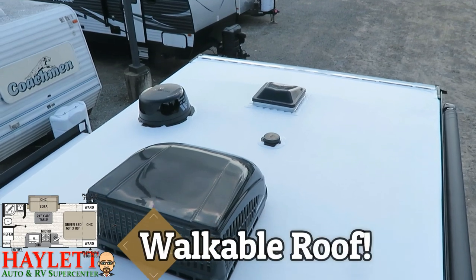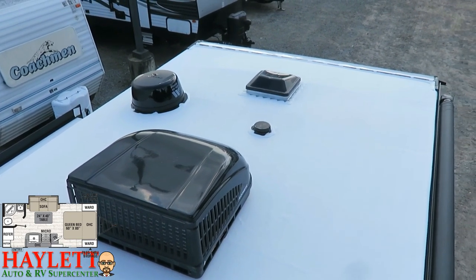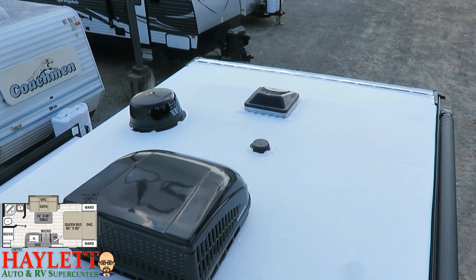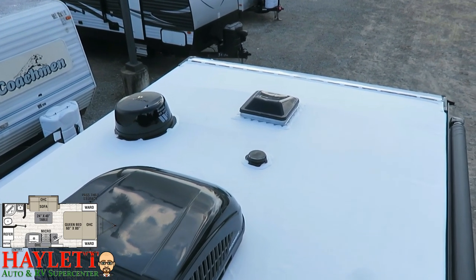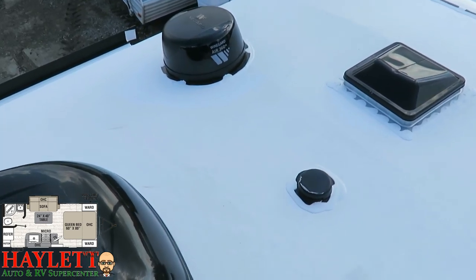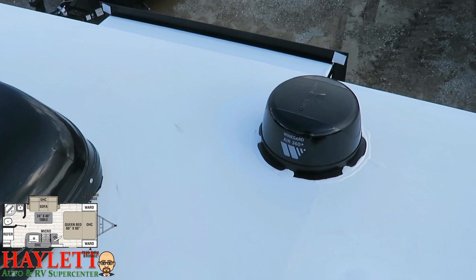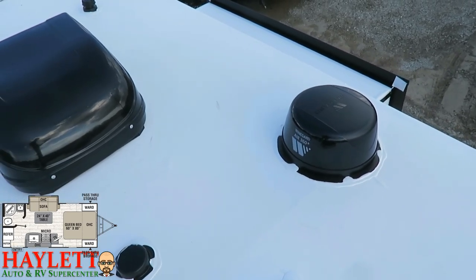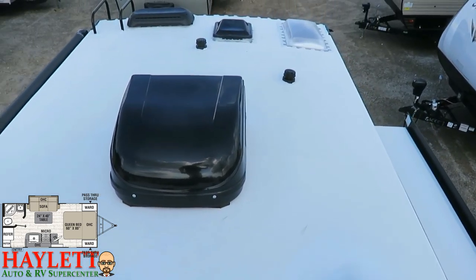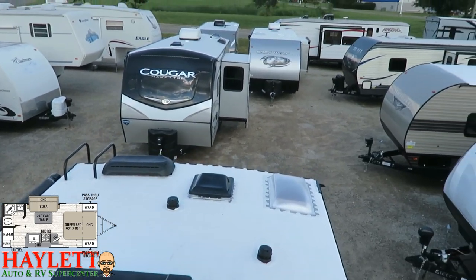The fully walkable roof is a great feature. Freedom Express historically had a tan exterior, then went to a white nose and white roof for heat reduction, and then made the smart move to go white skin across the board for the classic look and further heat reduction. They also added attic vents so heat trapped between the roof trusses can escape, keeping the RV much cooler. The Weingard 360 system means you don't have to crank an antenna up and down — just pop a channel scan one time and you're good to go for over-the-air TV signal at your destination.